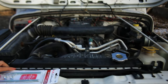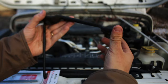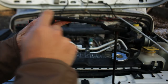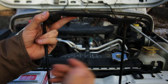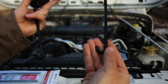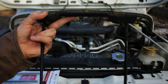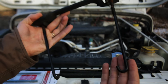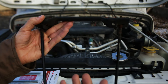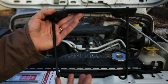In my opinion, the best way to go is to get one of these — the early model factory hold-down clamp for the TJ. You have a nice stout metal bar here. These things are rubber coated, so you're going to have lots of grip. The J-bolts are much, much beefier and the shape of them is nicer too, which means you're going to bend your battery tray less. I think they're better than going for some crazy $200 battery mount. It's just simple, it works, it's worked for a long time, and I don't think anyone really has a problem with these.